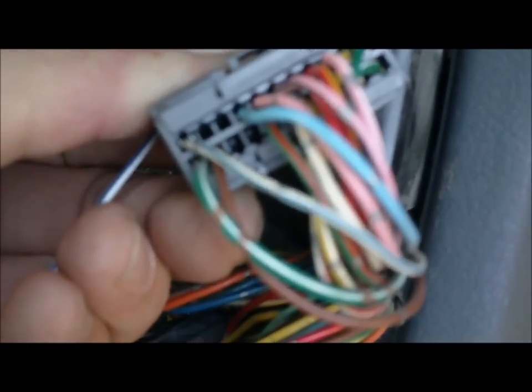This plug is the same process, except the pin you're looking for is on the bottom as well — it's the third over, so one, two, and this empty hole next to it is three. That is the D4 pin and that's for your VTEC pressure solenoid or sensor. Same thing: pop the top off, connect your butt connector with your piece of wire and run it into that third position from the left on the bottom row, and push it in there. Now your VTEC will work correctly with the ECU.